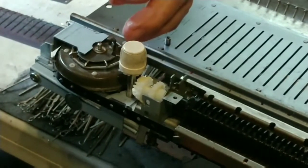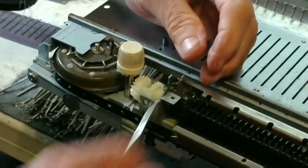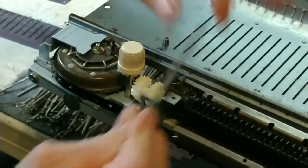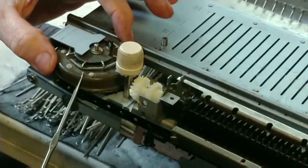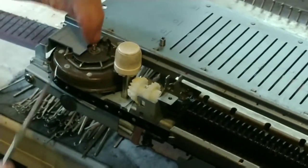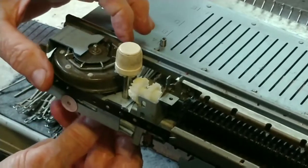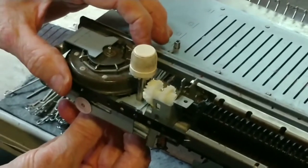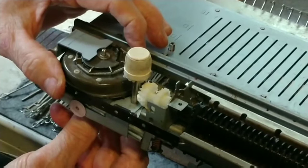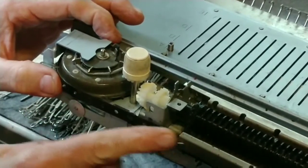If this doesn't line up so that the hole — which has the red straw now — isn't lined up with the horizontal flat of the cam rod facing straight up, this has to be disconnected from its drive and lifted up and rotated independently. And believe me, this little shaft in the middle will fall out the bottom when you do that. It takes about six hands, and I don't recommend that homeowners do it. If you're really good with your hands you can do it, and the manual shows you how.